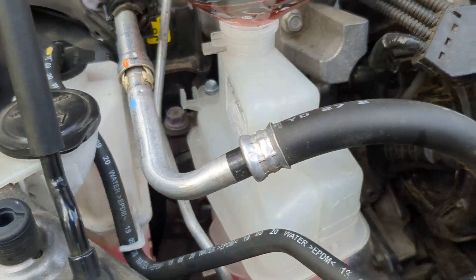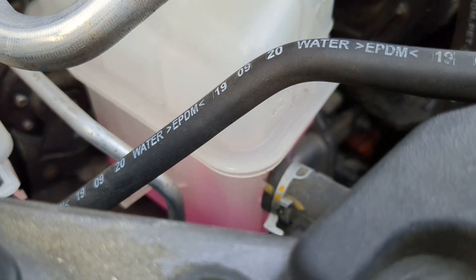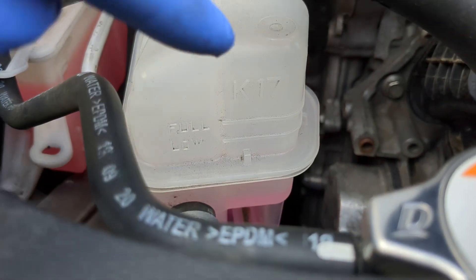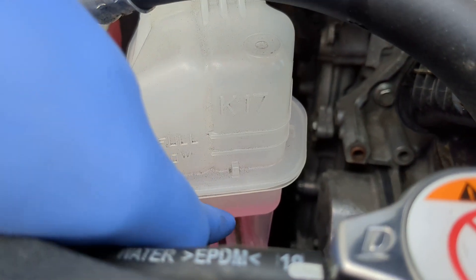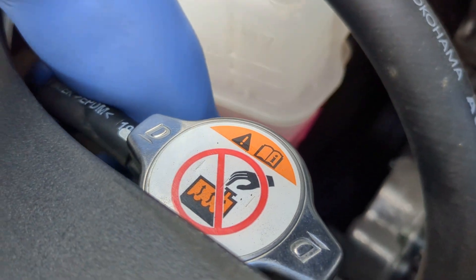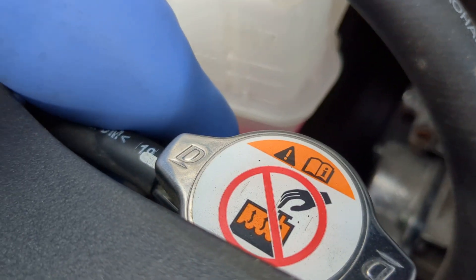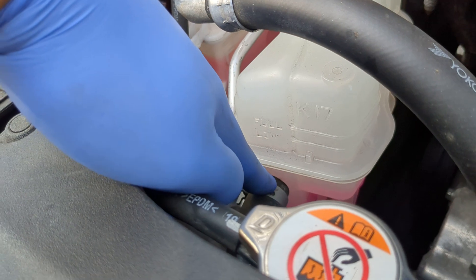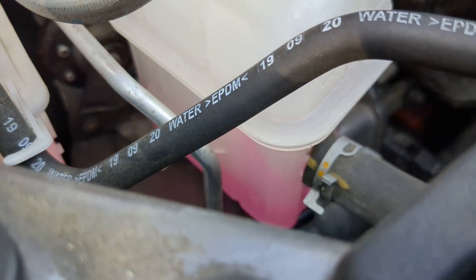This video shows how to check if the inverter water pump is working. The reservoir has been drained down to just a little bit above the inlet level so no air gets inside, and slightly below the feeding hose so you can see if there's coolant coming back from the pump.